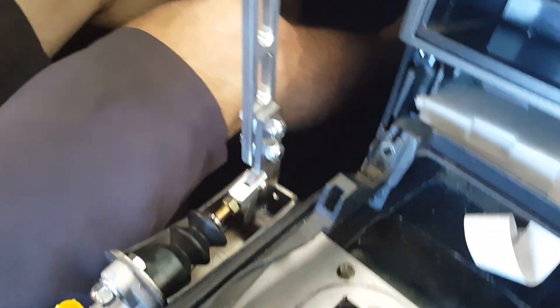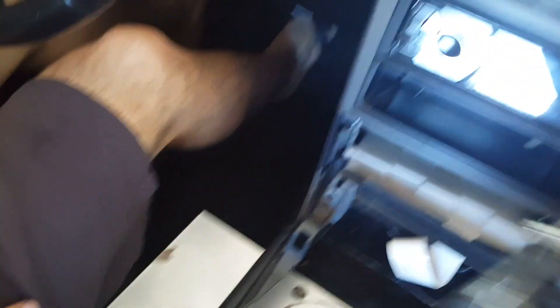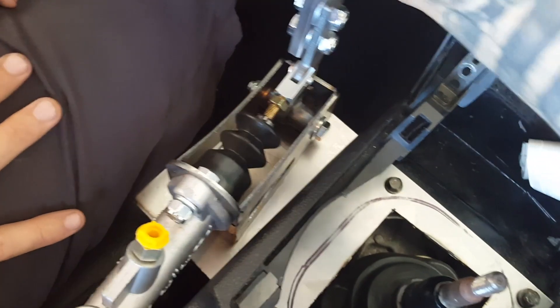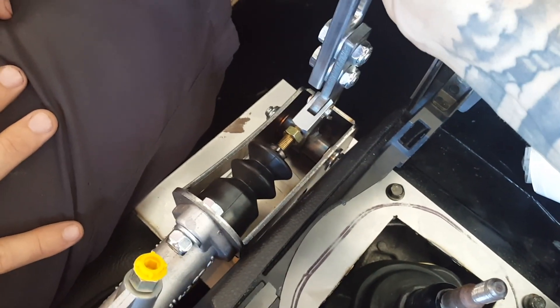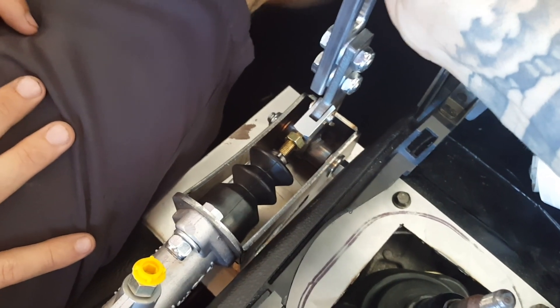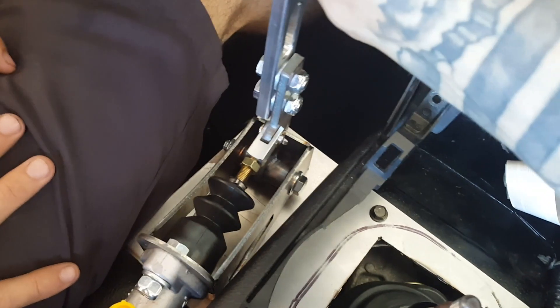Here's a thought — if you actually drill a hole in one of them, make a cut and then a cut, you could always loosen it and adjust to however you want. And if you really want to get fancy with it, if you have it centered there and only do the back, then you'd only have to loosen the back bolt, make an oval shape, and you could have it. Then as you find the way you like to drift, you could move it right there.